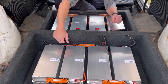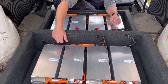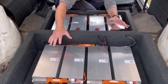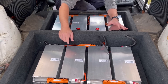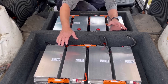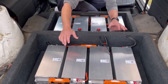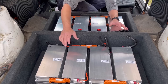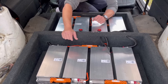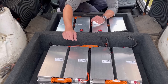I have to say it is working just fantastic, but this is temporary — I have said that earlier. I am using a Daly BMS with those modules to protect them when I am charging the battery. When I am draining and using the battery I just have to take care of the voltage manually and cut off everything in time. I will use a high voltage battery later on together with a complete new drivetrain for this car, but this is for now — maybe for a couple of months or until next spring.